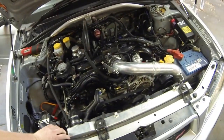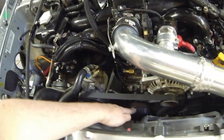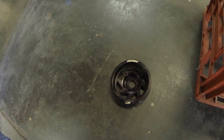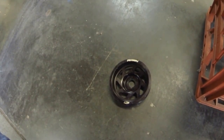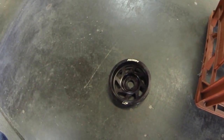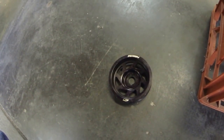I need to be clear of the belts when I start it. I had to do one extra step — I had to put my original crank pulley back on. I was using a Perrin crank pulley, but unfortunately these don't actually have a timing reference mark on them, so I had to remove it to check timing. What I'll do when I put it back on is set the engine on the timing mark so it's lined up, then swap the pulley over and make a permanent mark on it so I've got it there if I ever need to do it again. It's a bit disappointing to have to go this extra step, but it's not too much work — just a little bit of annoyance.